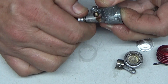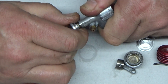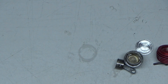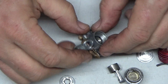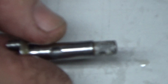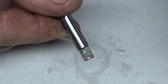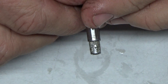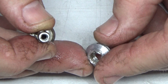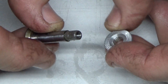I wanted to pull this crankshaft out, but it was giving me some trouble. I got it off — here's our cute little crankshaft. You can see that was a knurled area and it's pretty beat up. Now if you look inside the drive washer, there are no knurls in there at all — it's basically just spinning. And it looks like somebody may have attempted to do some staking or something like that to it.